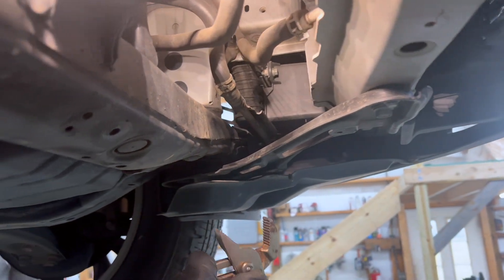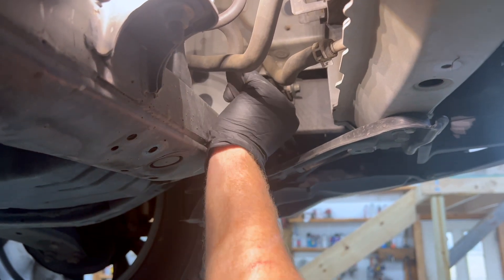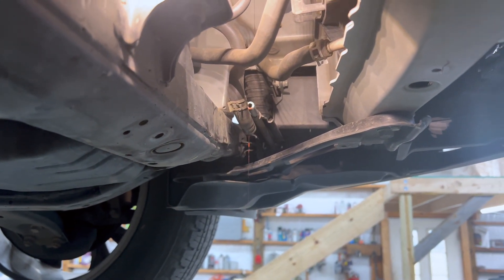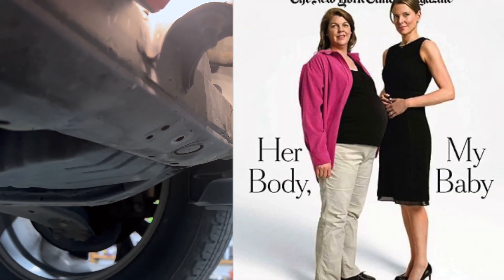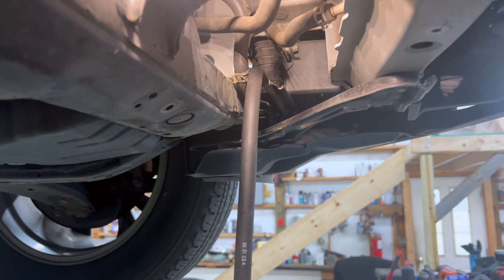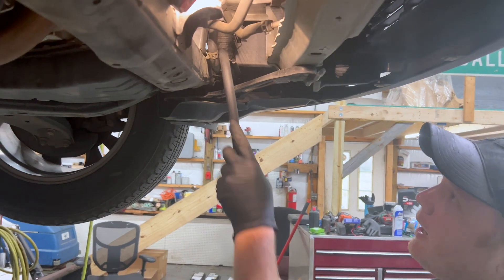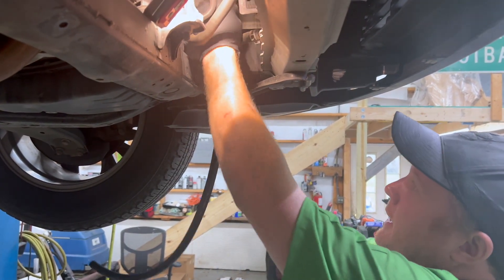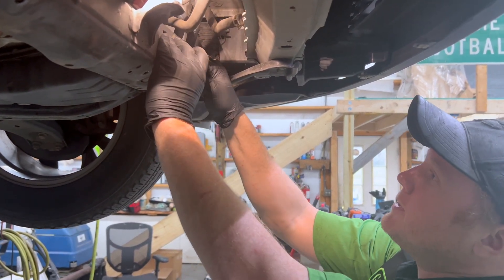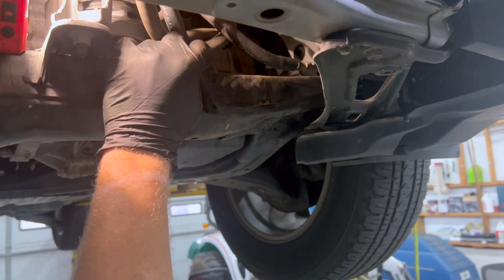Spring clamp, pull it back. Now you're going to take a piece of surrogate hose — this is a three-eighths fuel line — and you're going to jam it onto the end of the line. The reason why we don't really care about which way the flow of transmission fluid is going is because I'm just going to run both of the female sides of the hose down into a bucket. So I'm going to zip tie these together and zip tie them in a way to make them both pointing down.